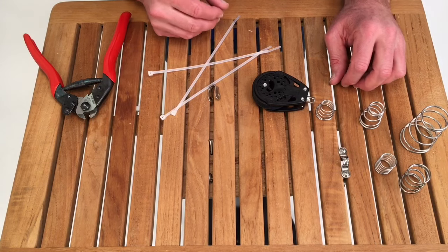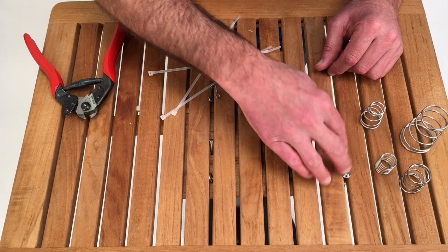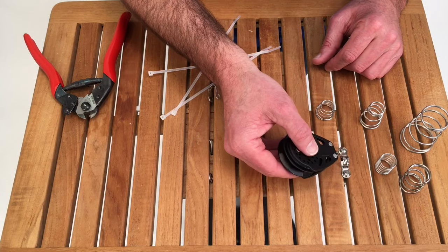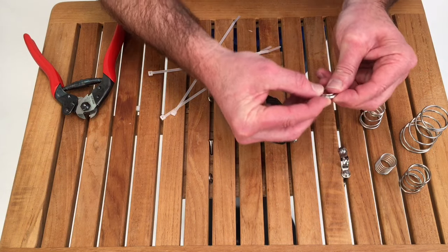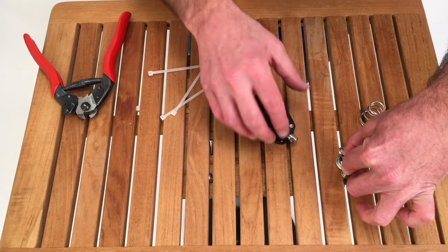We're here to show you how to install a stand-up spring or a PVC boot to a fixed point or a traveler car when attaching a block to keep it up. These small ones — tapered or untapered — are pretty easy to compress. I could put it over the eye, hold it down by myself, and shackle it without much problem.